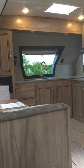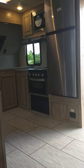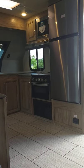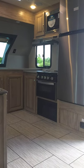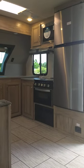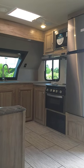Thanks for purchasing your trailer here at National RV Detroit. If you have issues you can give us a call — we'll work with you, set up a service appointment, talk you through it. There's a manual for every appliance in here, and you can go online and use manufacturer videos which are accurate. Stick with the manufacturer's video — for example use the Suburban range video rather than a third-party one. Make sure you inspect your roof three times a year at least, and always bypass your water heater when winterizing.